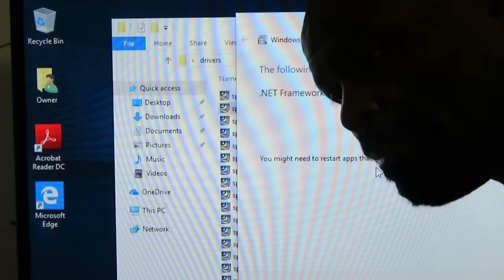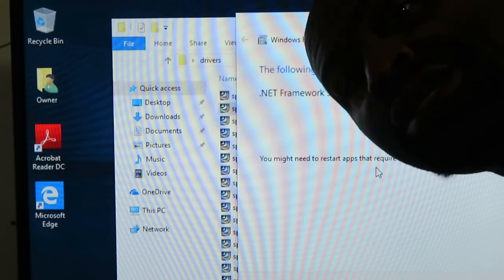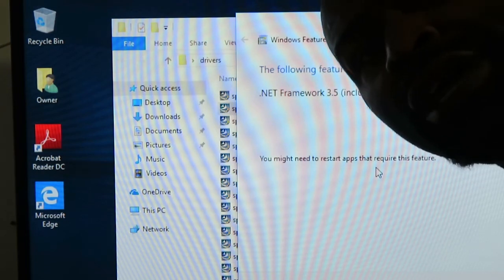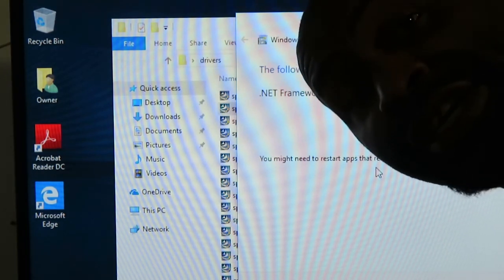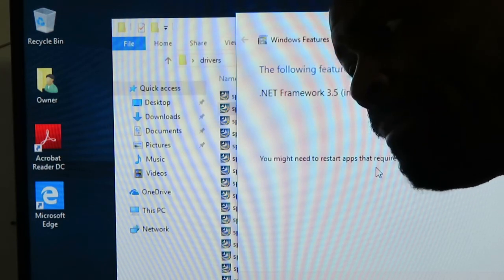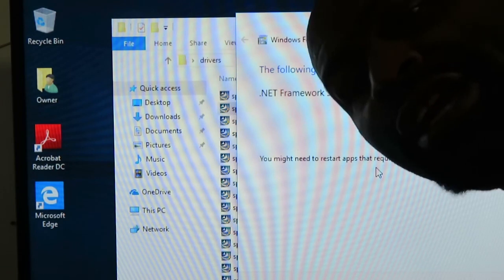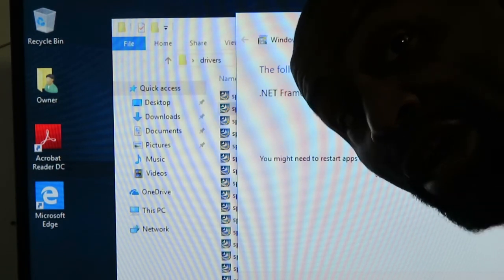Check your BIOS. Now, how do you check your BIOS? Upon starting up your PC, there's different function keys. Some are F8, F4, F2. They'll get you into the BIOS setup. Okay, it's almost like going into safe mode, but it will give you the option to see your BIOS. Once you get in there, you look for the word BIOS. Very simple. It will tell you the year of the BIOS.